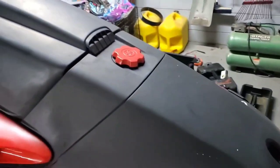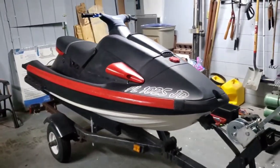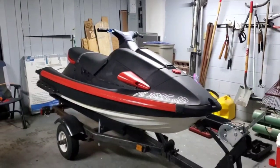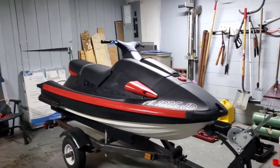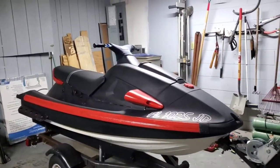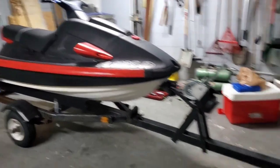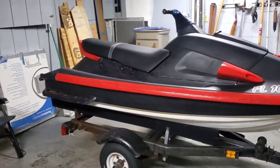We're not going to know until we hit the water. But, yeah, we'll know more once we put it on Lake Thanota Sassa, which is a private lake, and we actually take it out and rip it around a little bit and see how it does. I have no idea how old that gas is in there, but the fact that it's running on it is good. However, before I take it out to the water, I may actually stop and put some fresh gas in it and do some more 50-to-1 mix, because I would like to have some fresh fumes rolling around in there if possible. No clue how old that gas is. It's got 3/4 of a tank of fuel in there, and we don't know how old it is.